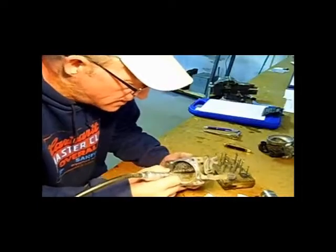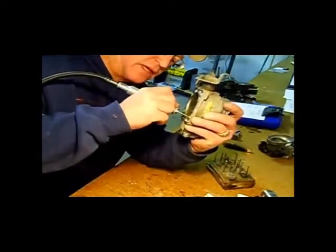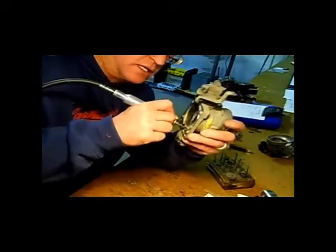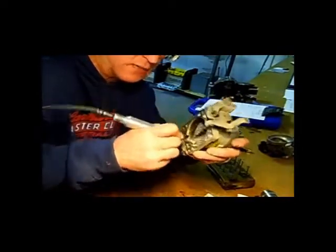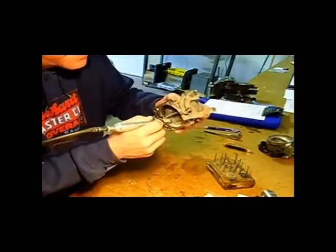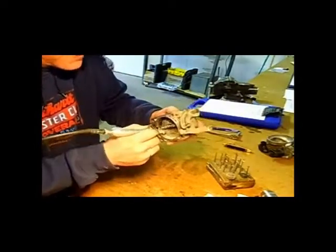Now, I'll show you what a good angle is. If you look here, you can see that the angle of the bit is up by about 15 to 20 degrees. It's somewhere in that range. Now, when you do your cut, if you get out of there quickly, you get a case where you can see there's no side-to-side motion of that bit. It's locked into place. That's what you're looking for. The closer you get to zero movement, the closer to a perfect groove you have.